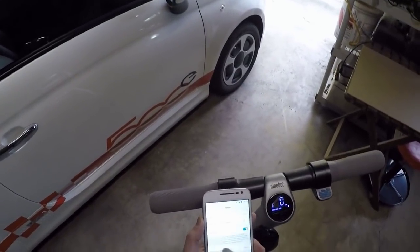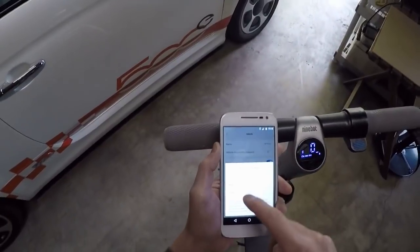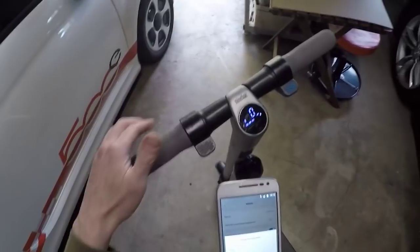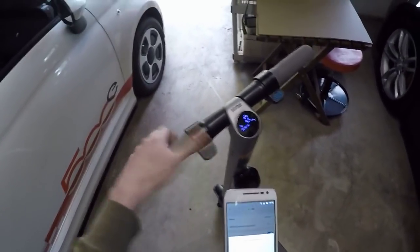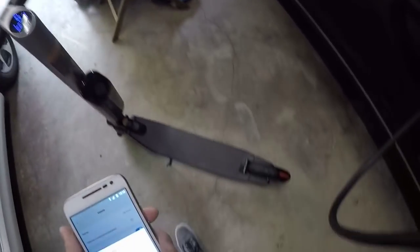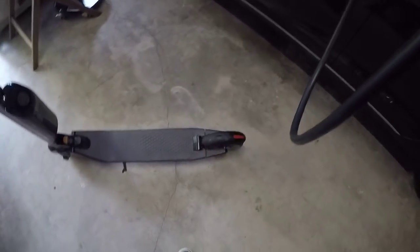And then this has energy recovery level. You can adjust it right here. There's weak, medium, strong. I leave it on weak because I want to coast as much as possible. And any time that you actually want to brake, all you have to do is push this lever, and all of it's regenning. So anytime you push this, you're regenning. The only time you're ever using any kind of friction brake is back here on the rear wheel, so you try to avoid that at all costs.